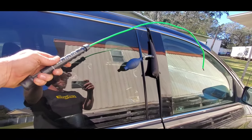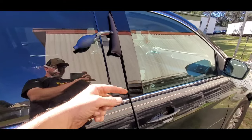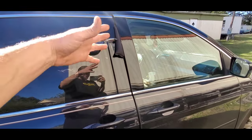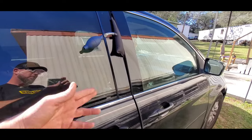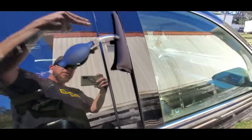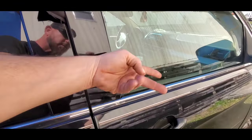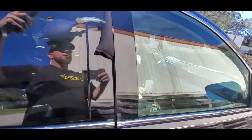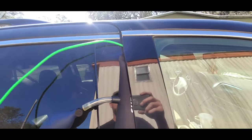If you don't have one of these fancy unlock tools and you're doing this yourself at home, you could take a piece of plastic banding — the white banding that goes around a box, about that wide and real thin. Cut it maybe three feet long, fold it in half so it looks like a V shape. Stick that in through the window, get it to come down over the lock, pull back tight, and snatch up — that'll unlock it. You can also do it with a thin enough belt.